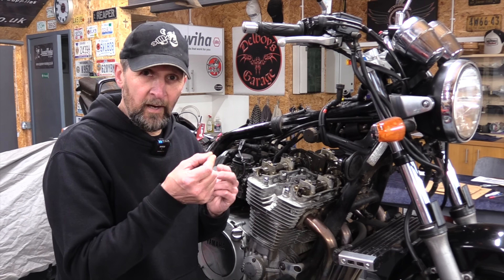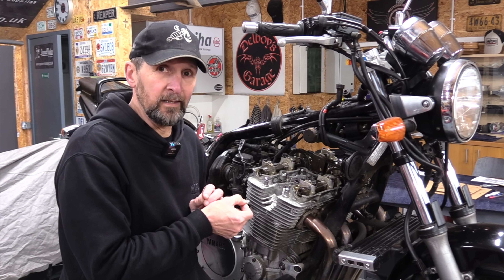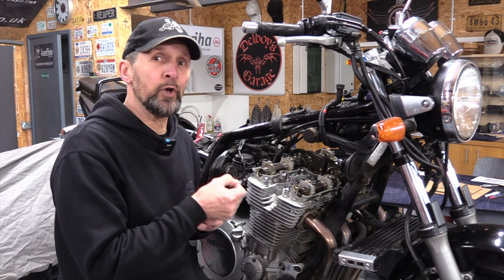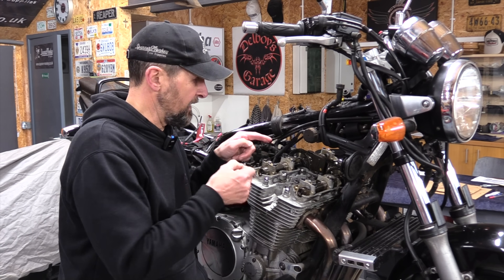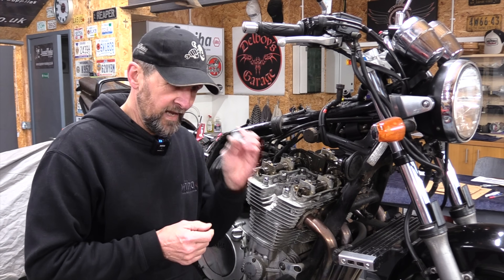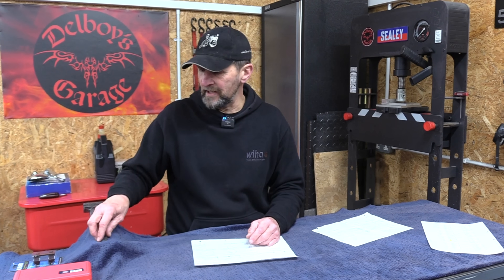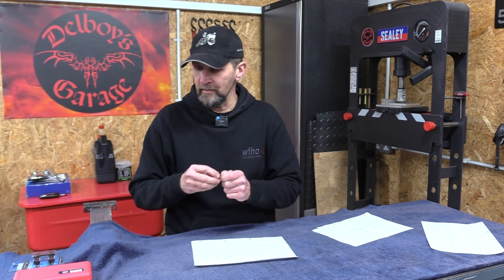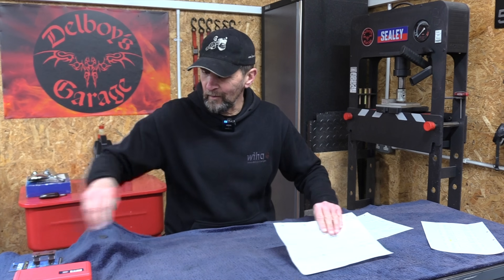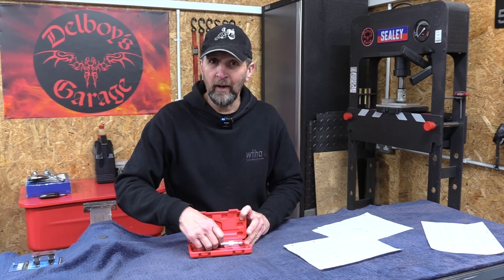But you and I — us mere mortals — don't have that luxury. Our life is a lot harder. Here's what we have to do: take a shim out, record the number on a chart, then put it back in — because we don't have a stock of shims to replace with the correct one. We put the old one back in, then go to the next lobe and do that one, and so on, until we've done all 16. Then we have some mathematics to do. To do that mathematics accurately you need to record the data accurately, which means buying a micrometer.